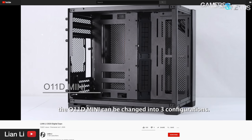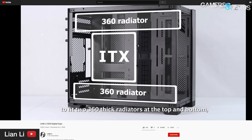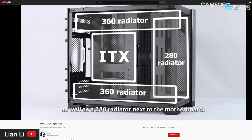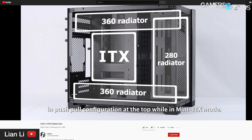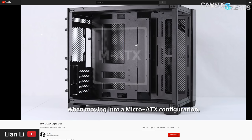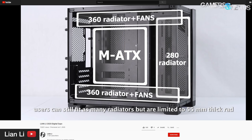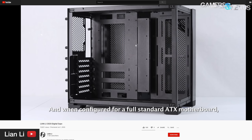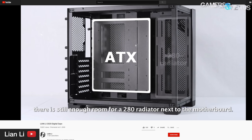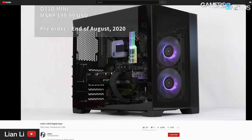The case is an extremely large Mini-ITX case, or a very small ATX case. It's modular and can be reconfigured to Mini-ITX, Micro-ATX, or ATX — though we think this is largely a gimmick. Lian Li says the appeal is that you can use one case for all builds going forward. The ITX configuration supports two 360mm rads top and bottom, and one 280mm for the side, with the 360s capable of being thicker radiators or push-pull configurations. The M-ATX option is limited to 55mm thickness for top and bottom coolant, while ATX still supports a 280mm side mount.